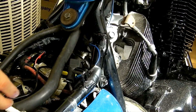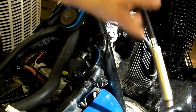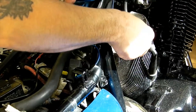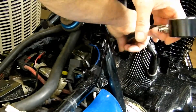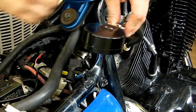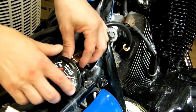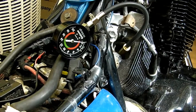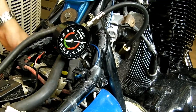While waiting on the fuel pump, I'm going to do a quick compression test on both cylinders. When doing a compression test you should actually do this with a warm engine — run it, warm it up, stop it, remove all the spark plugs, and then do the test. However, what I'm doing here is just getting a guideline. Even with a cold engine you should get a sense of how good the compression is and whether it's consistent across the cylinders.